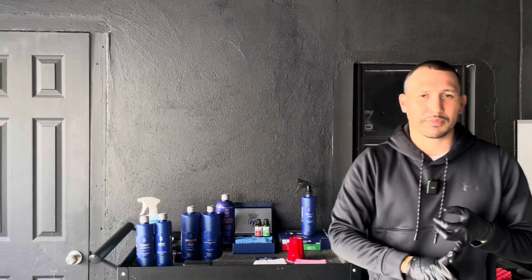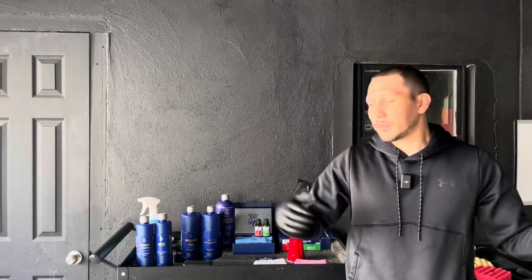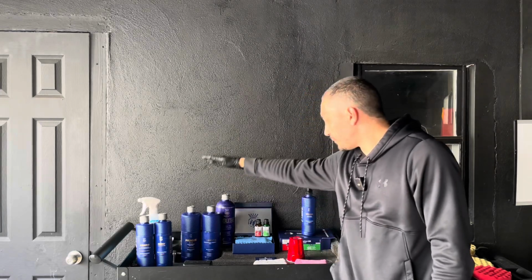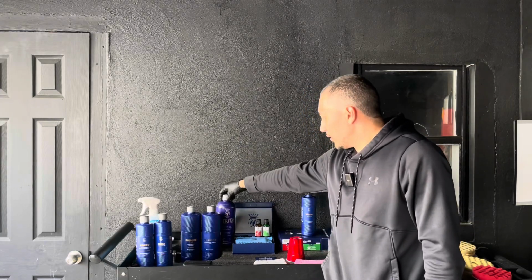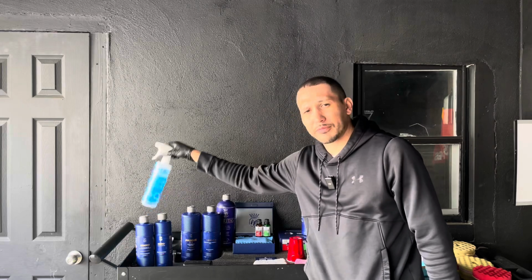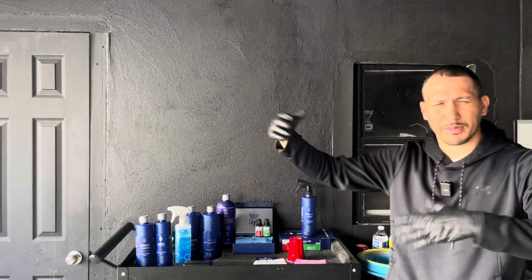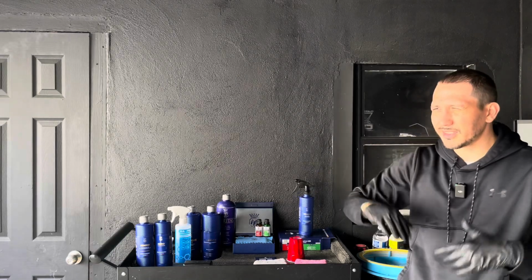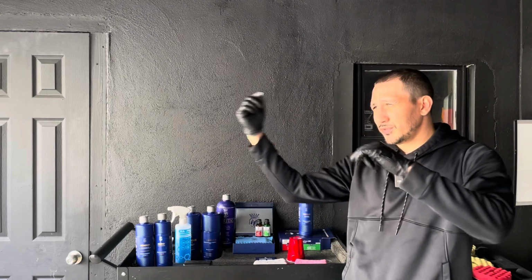And for the wheels and tires, we used Ethos Total Wheel Cleaner, and for the tires, we used Armour Detail Supplies Tire Cleaner. That's about it, really. As for the prep process, Primus and Purifica. We used Nero for the tire dressing, Nero as the iron remover, diluted 1:4. Veritas as the panel prep, diluted 1:2 this time, because last time I used it 1:3 and somebody said that wasn't strong enough. Nitido for the glass cleaner, and then we used HPC to coat all the glass.